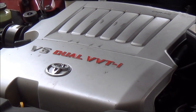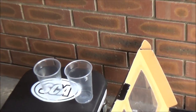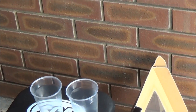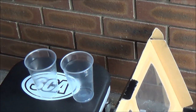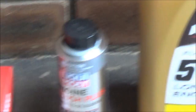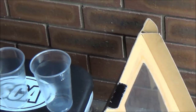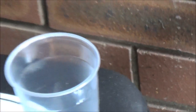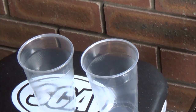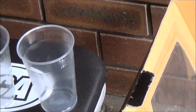The way I'm going to do this test is very simple and straightforward. I need two cups. To the first one I'm going to get a sample of old used oil straight out of the drain plug. Then I'm going to fill the engine with the engine flush solvent and let the engine idle for about 10 minutes, then get a second sample. Then I'm going to drain the entire content into a drain pan and collect another sample in the second cup. So the first cup should have the normal used oil, and the second cup will have the engine oil that was flushed by the solvent.